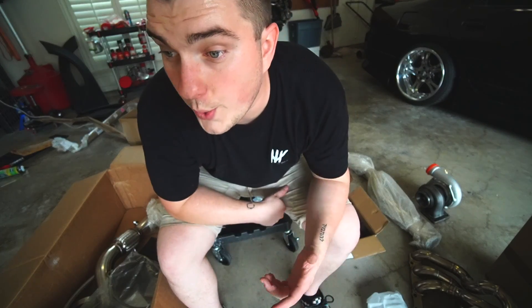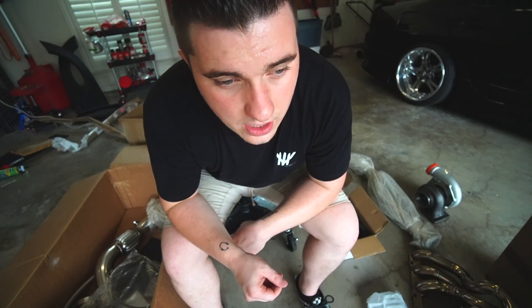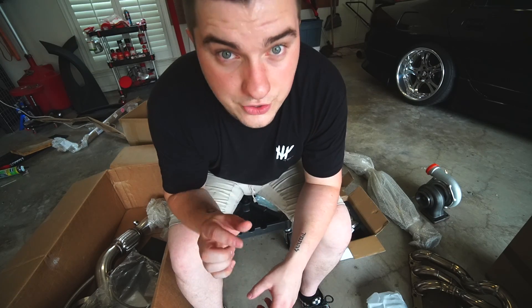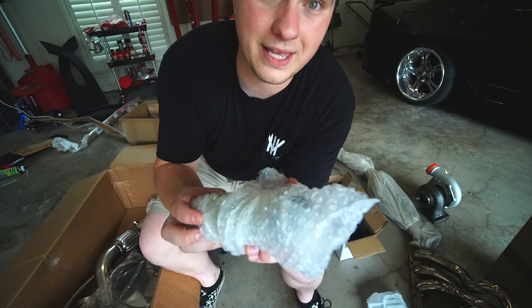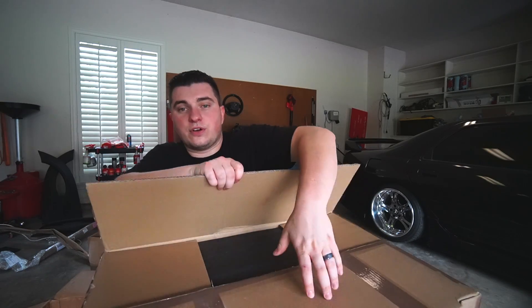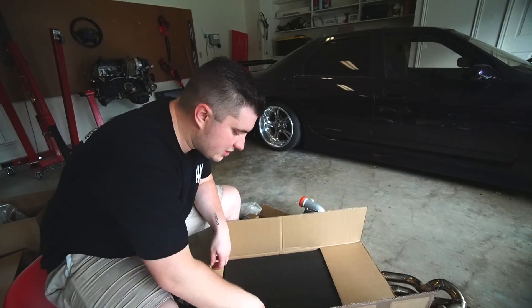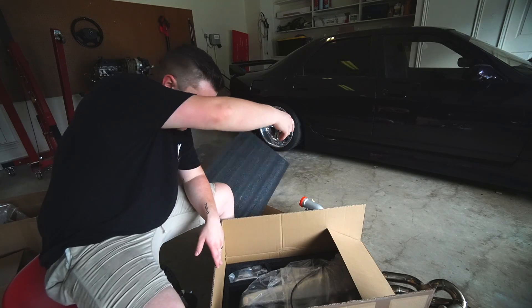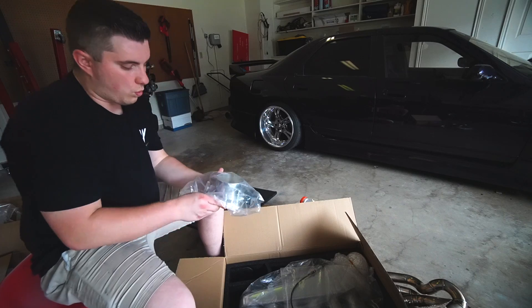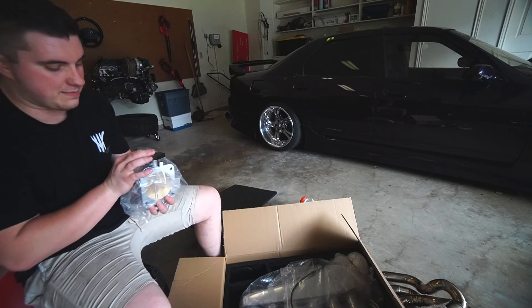You can go to most hose stores or racing equipment stores like Summit, or even Smiley's out here in Dallas, and get prefabricated lines at certain lengths. I believe 3AN is what I like to use to keep that pressure high. I also have a wastegate dump — I'll probably have that refabricated. When I got my Supra I had limited information about the naturally aspirated stuff, but since then I've learned a lot and I've seen how clean you can make some NA setups.